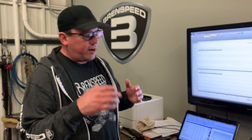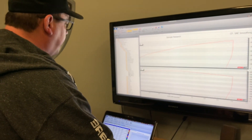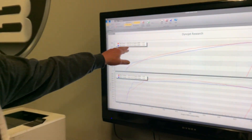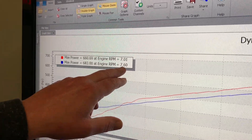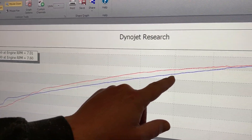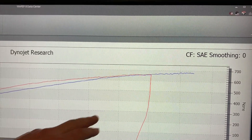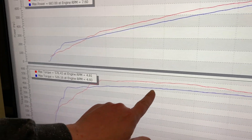Why 7,000 rpm? I make other videos where we go up to 7,600–7,700, but those particular kits allow the rpm range to go that high and don't come with a straight-up 3-year/36,000-mile warranty like this kit does. So if you have a new Mustang and want awesome torque, really good real horsepower, and want to keep the warranty, this is an awesome kit. Looking at the comparison graph — red being the Roush kit, blue being the other brand's stage-two kit with a 132mm throttle body — the other kit made 683 rear-wheel horsepower but went all the way to 7,600. The Roush kit shines through the entire rpm range to 7,000; the other kit's higher rear-wheel number is simply due to the extended rpm range. On torque, we're looking at 40–50 lb-ft more rear-wheel torque the entire rpm range.